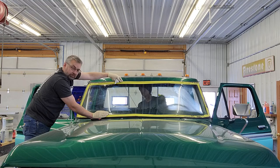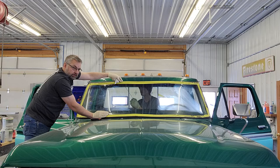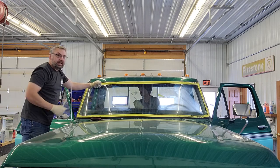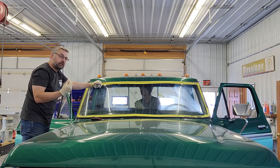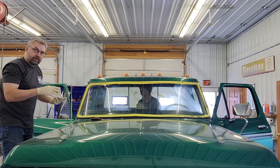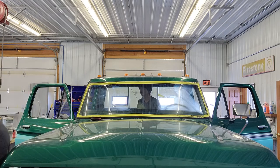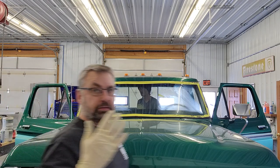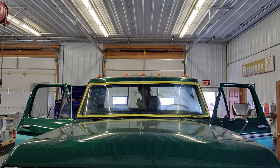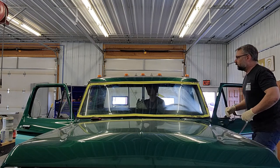You don't want to do that white knuckle pull with the rope. You see a lot of variance in the gasket strength here. Some of these gaskets are not as strong. The rubber will actually tear. It'll stretch all out of place. And the rope can actually saw the rubber. You end up with a tear in it. So we don't want to force things.